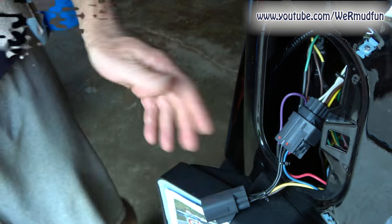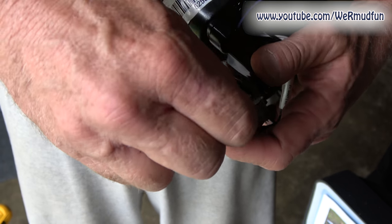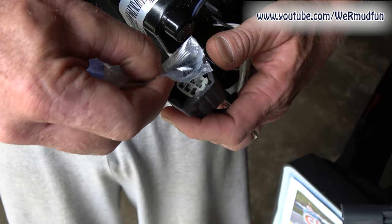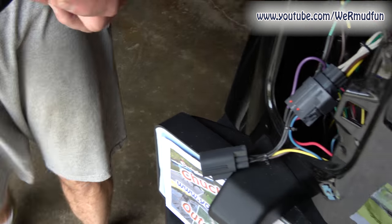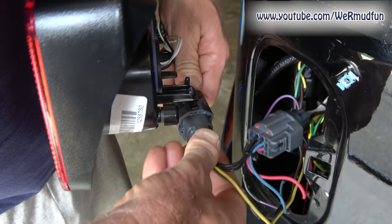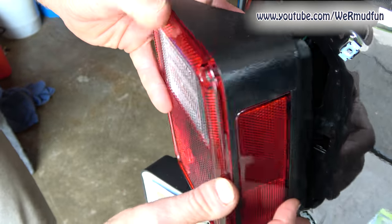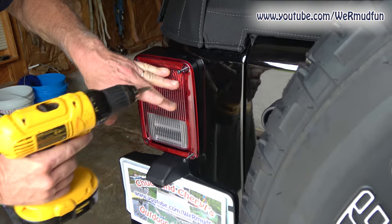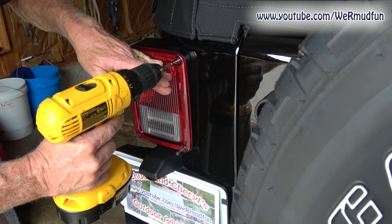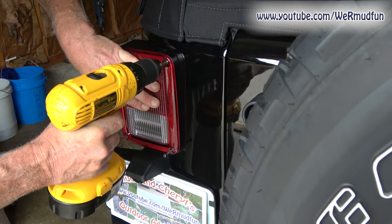Get your taillight and do the same thing — get the terminal grease on the taillight end, squeeze a little more, then connect that in. Tuck everything in and gently put this in the way it goes. Like we did with the tow hitch when you zap these back in — gently. Do not go all the way or you will crack the lens.